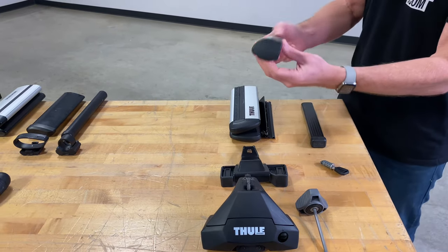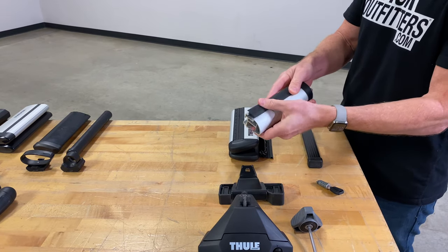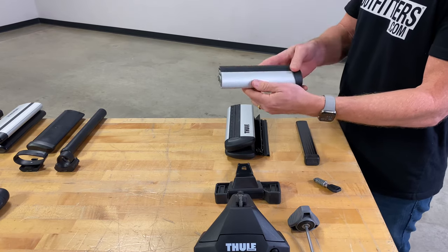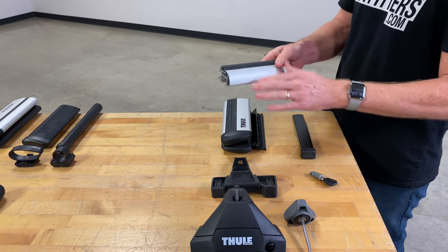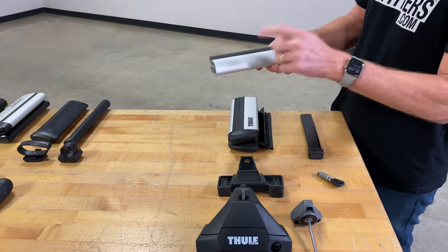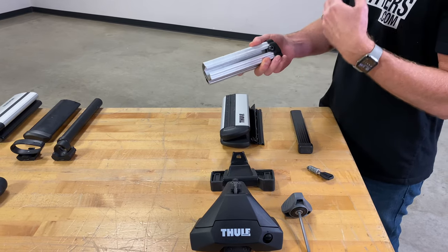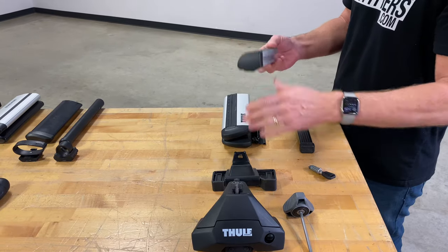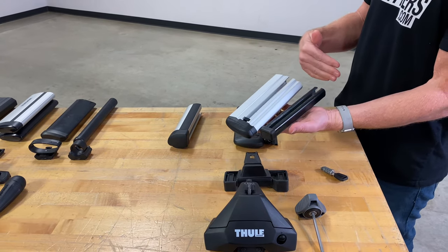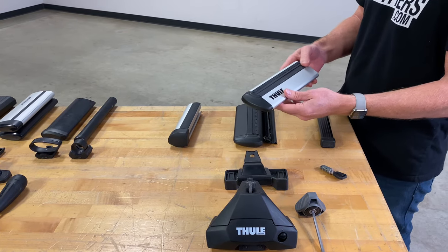Another option is the Pro Bar, which is an extruded aluminum bar. It has a slot on the underside and also a slot on the top side for certain compatible accessories, plus an additional slot on the back of the bar for compatible accessories as well. This bar is considered stiffer and stronger. However, keep in mind that the fit kit determines the overall weight carrying capacity of any given roof rack system, so it is vehicle specific. This bar comes in very long lengths, and because the underbar track extends the full length of the bar, there is no mechanical restriction on the bar length you use. With the other bars, the underbar track is at a fixed distance, so you generally have to stick with whatever length the manufacturer recommends, though sometimes you can go one length longer.